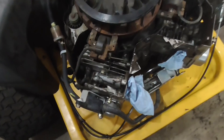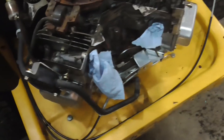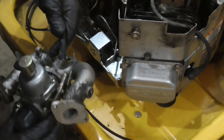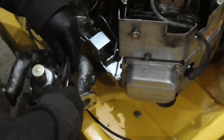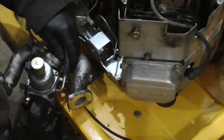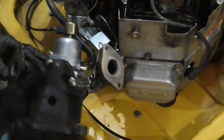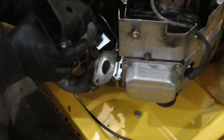It's pouring rain outside, so I decided I'd clean off these fins just using compressed air. I got them pretty clean — made a bit of a mess, put some goggles on and blew it out, but we're looking pretty good and I think we're ready to put the carb back on. We're ready to install the carb — I'm going to start with the fuel line, push that on, and lock the clamp. Next we'll do the linkage with the hook for the throttle. Put that on, and we'll do the fuel solenoid so we don't forget that.